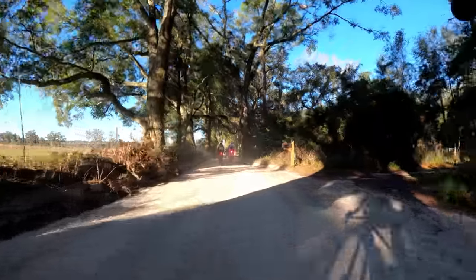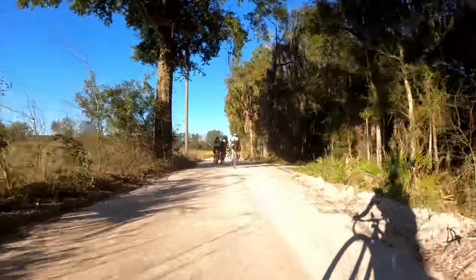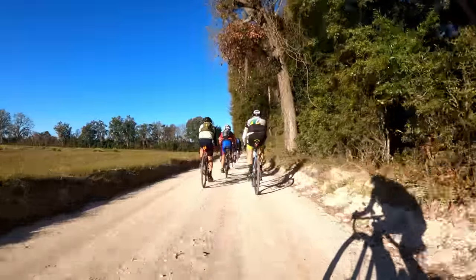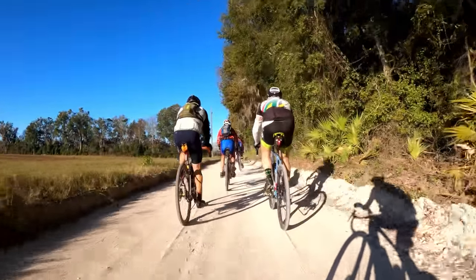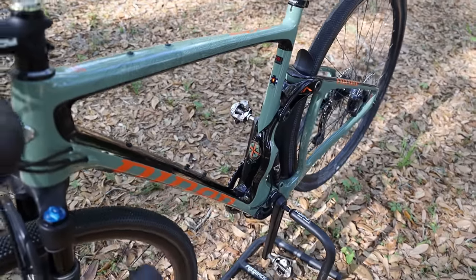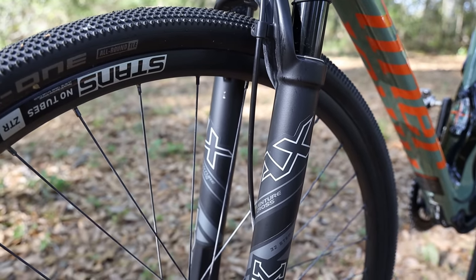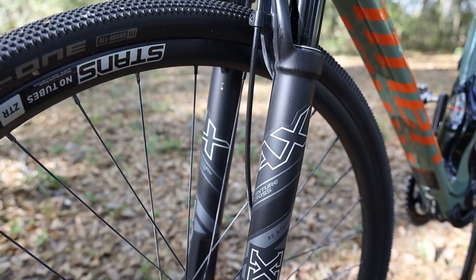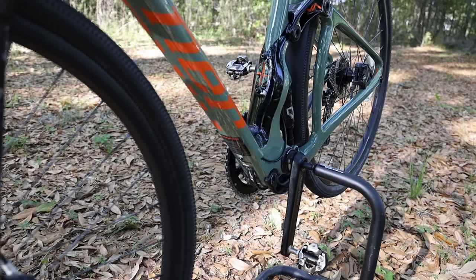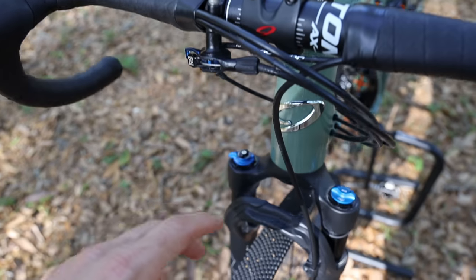With this bike being so much more comfortable than a standard gravel bike, are there any disadvantages? The main disadvantage is weight — this bike is about three pounds heavier than a standard gravel bike, which you'll notice if you climb a lot or on group rides with surges where you're sprinting or pushing hard. There's also going to be slightly more maintenance than a standard gravel bike with no suspension, just like with mountain bikes. I have three full suspension mountain bikes and the maintenance really isn't a big deal — about every six months I change the oil in the fork and the float fluid in the rear shock. And finally, you have a little more to think about when riding, between locking out the rear shock and the front shock.